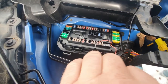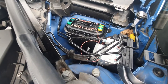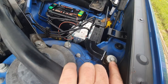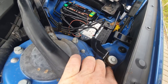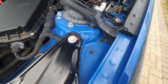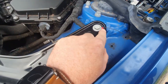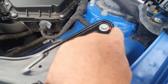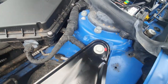Please ignore this red wire - I'm in the middle of fitting this. You're going to have a positive and a negative. I've found different points in this vehicle to put the negative onto. Some people might try down here - don't, it doesn't work. It's actually rubber, there's a rubber bush under there, and I couldn't get a good ground connection. So what I had to do was move down to the brace - I just loosened off this one here. There's a small spade connector that I got out of the box with the negative into it, and then it's just screwed down. That's given me a really good ground, a really good negative connection.